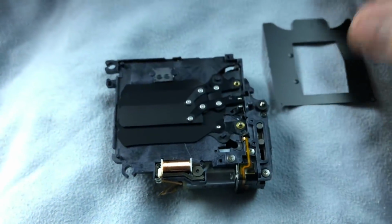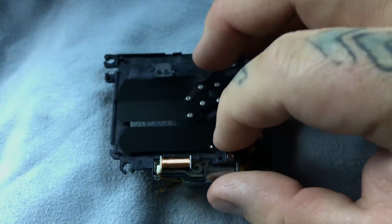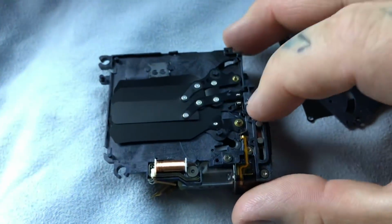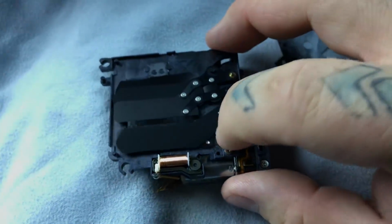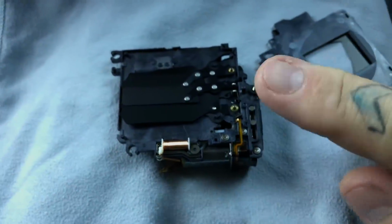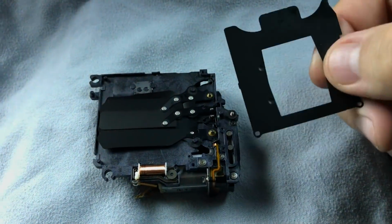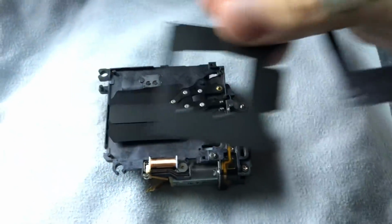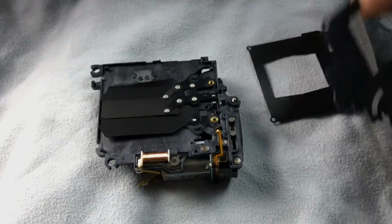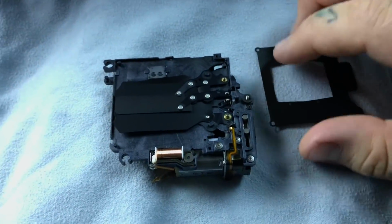this vignette, which is in there, and the back plate, which actually holds everything into place. That's why the shutter blades have kind of slammed into place there. But anyway, you get the point. Also, it's fallen off of this pin, but I made my point. The shutter mech is not meant to be, one, operated manually, and two, operated without its vignette curtain, which is a metal piece which drops a screen around everything. And it also has these placer mechs that these pins rest into. But anyway, you get the point.